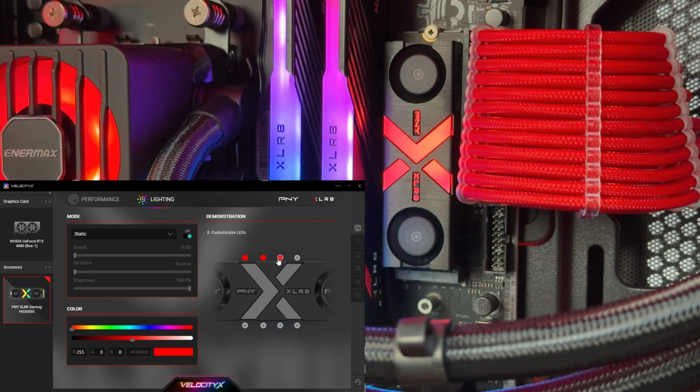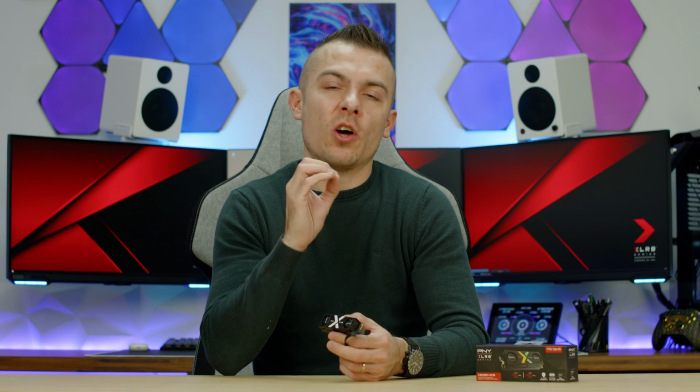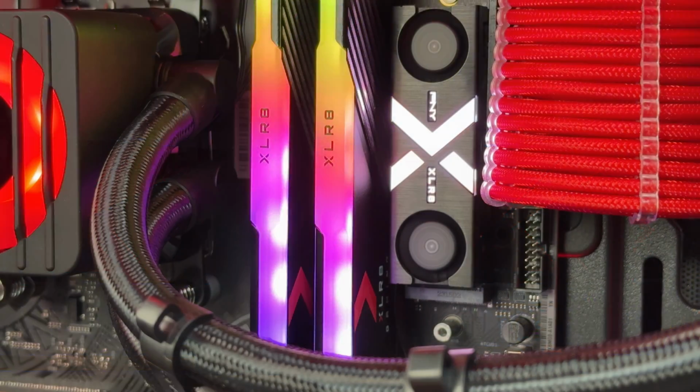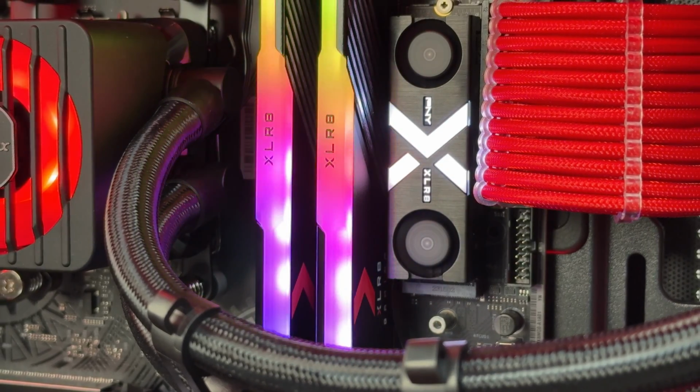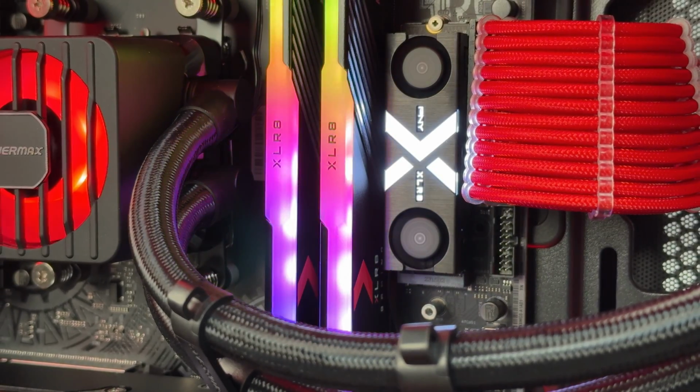This is most likely the first SSD that has integrated fans that you could actually regulate, that you could adjust the speed to your liking, set the curve, full, automatic, it's all up to you. And it's quite interesting that at 10,000 or 10,500 RPMs, the fans are totally inaudible. And this is really cool because they spin really fast, and they create additional airflow through the SSD, cool it down, as you can see, quite nicely. And yeah, 16,000 is really unbearable at some point because they tend to act like those small 10K fans that go into servers usually. But apart from that, you can regulate the speed and do whatever you want. Plus the RGB is quite easily adjustable, and thankfully that works without a single problem.